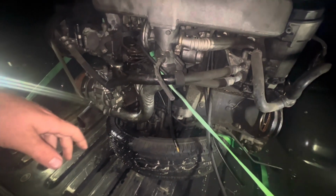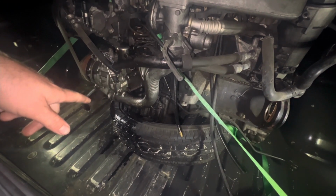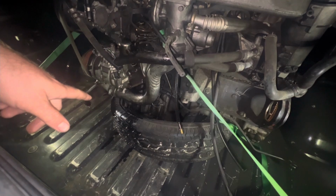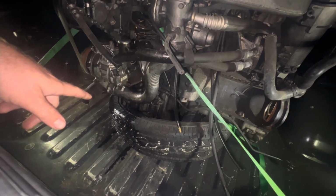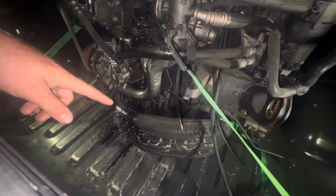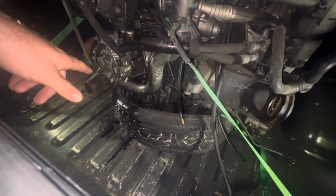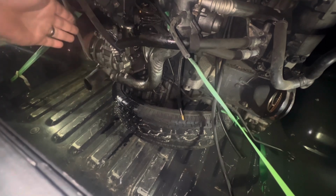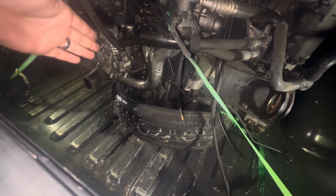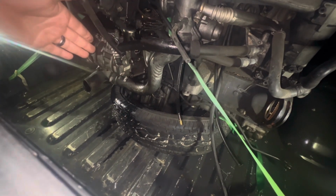Another thing that I just now remembered to speak about is the front sump. You can get an oil pan, oil pump, and oil pickup from a 648, I believe. Could be wrong, pretty sure I'm right. And then that makes it a rear sump. And then, yeah, that'll be a lot more room up in the front where the cross member is, but in the factory application in the C4, the crank itself was almost behind the subframe, and with this one being about 3 inches longer, we should still have plenty of room. We will not be needing this fan.